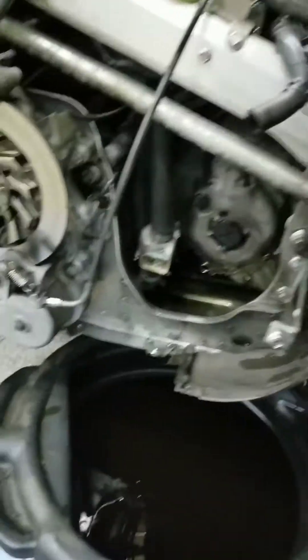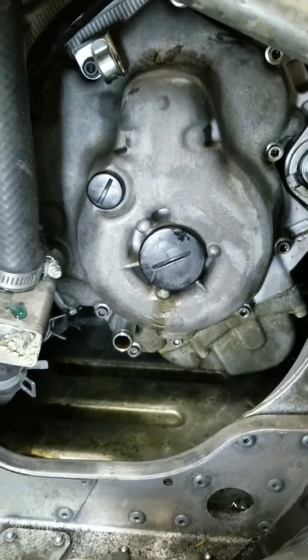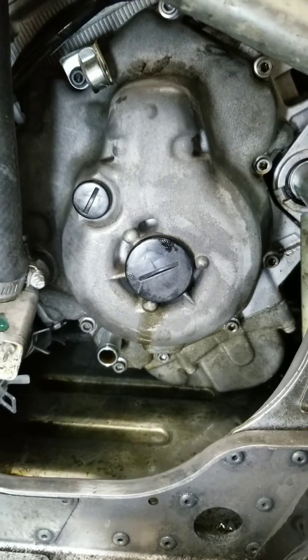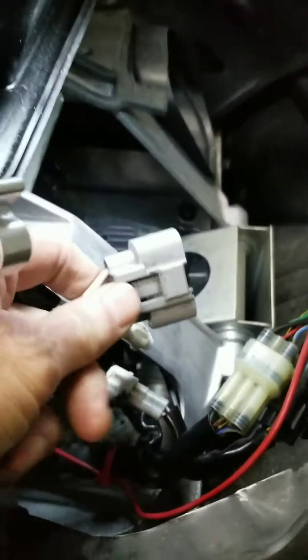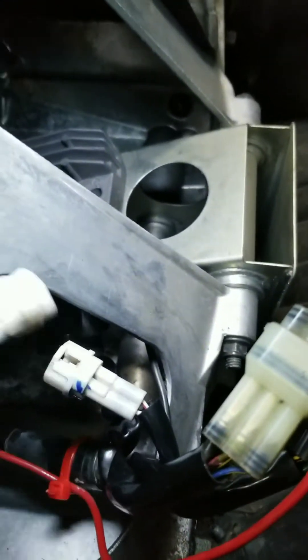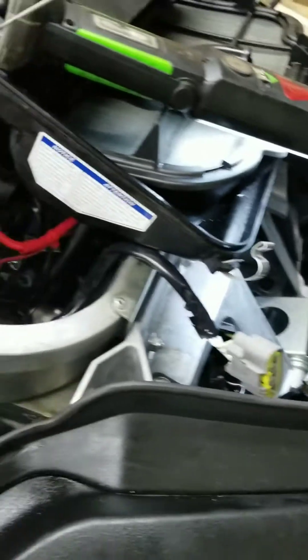The side cover is off the machine. I removed the oil tank — actually quite simple, just a few hoses, I drained the oil out of it. You can see that cover with the two plastic screw-off covers is the cover for the side of the engine, and the stator is mounted into that cover from the back side. There's a cable coming out of the top routing over to the regulator. Make sure you've unplugged the gray cable from the regulator and then disconnect the small connector — those are the two ends you have to unplug, it's all part of the stator connector.